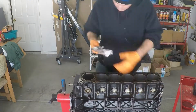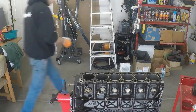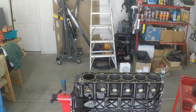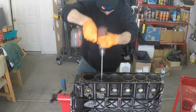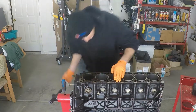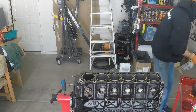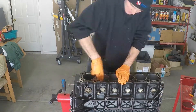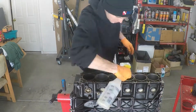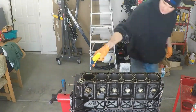These bores are 89.9 millimeters, so the honing tool you need is a 90-millimeter flex hone. Also, be sure that you're making your way all the way down and all the way up inside of the cylinder bore — you don't want to stop halfway through and reverse, because you'll get an irregular hone that is not uniform, and that's bad. Also, make sure that when you are going into and coming out of the bore while honing, you're not letting go of the drill trigger — you want to be going in spinning and coming out spinning. You don't want to stop the drill and then pull it out, or you'll scratch the cylinder bore and destroy the crosshatching.